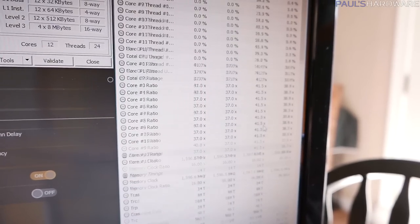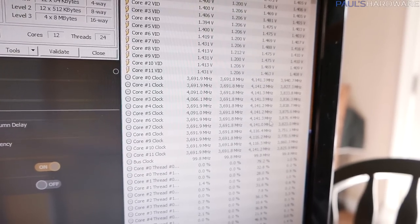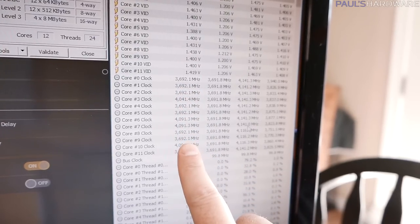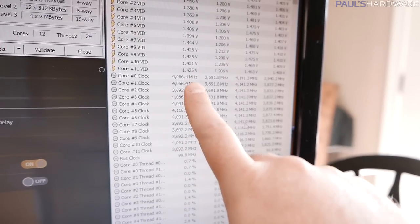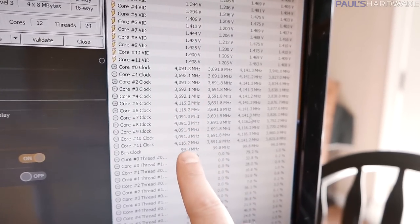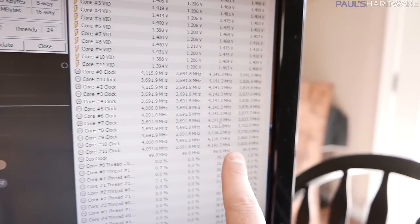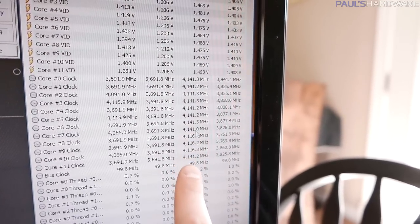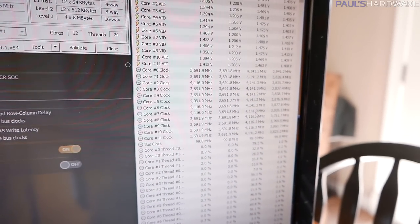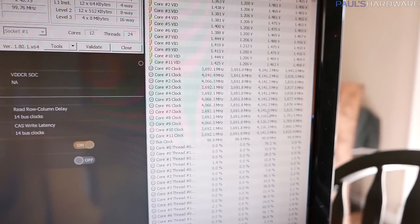Since this is the 1920X with 12 cores, you can see all the cores listed here. At stock, it's actually going to run at about 3.7 GHz when running on most of the cores. Individual cores, when using say 2 or 4 of them, can actually boost up to well beyond 3.7 GHz — we're actually seeing about 4.1 to 4.15 GHz is what the cores are hitting individually. But of course when we're running a load test, it's going to be running across all the cores.